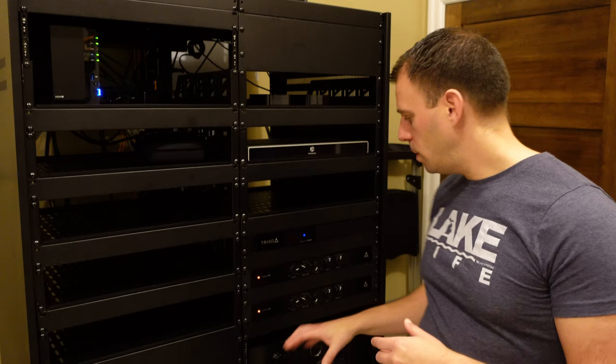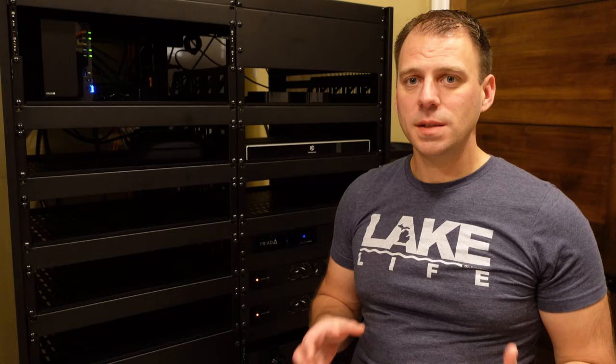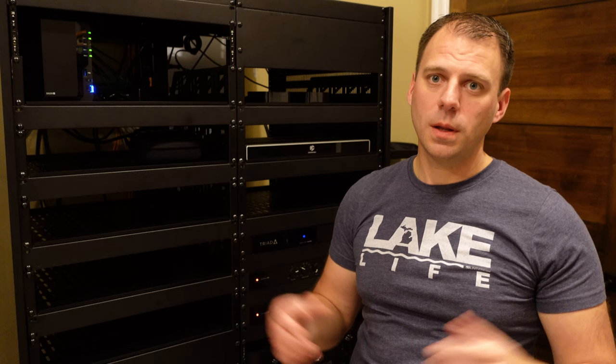Trigger one on the Marantz goes to the theater space, configured in the menus for the main zone on and off. I really wish the REL subs had some type of wire trigger capability, but they don't — it's just manual on/off or auto-sense, and honestly it's the lamest part of my home theater. Every time I go in, I turn everything on, the triggered stuff comes on reliably, but then no subs yet. I start playback and I'm sitting there waiting — did the RELs come on? Do I see the white light behind them? There it is. Subs are on. Now I have peace of mind that the system is working the way it's supposed to.